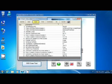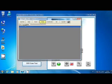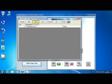Then obviously, as an OBD scan tool, we can erase the errors that are stored in the ECU by Clear MIL. It's the same as making Clear MIL in the OBD Adaptivity tab. Okay, it's the same command. So now we can clear the error. Okay, now we return to the errors tab, and you see that there is no more error here, and no freeze frame. Okay, no information about stored DTC.